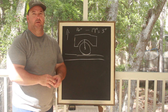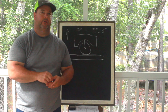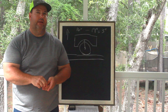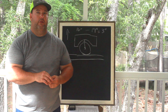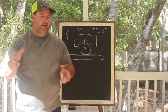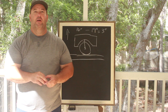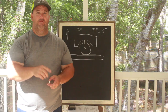Are you foot braking or using a trans brake or dumping a clutch? How much front end travel does your car have? How much power are you putting down — use the link in the description to calculate horsepower. What are your current 60-foot, mid-track, ET, and mile-per-hour times? Are you racing on prepped or unprepped surfaces? And last, the 12th: video, video, video! I need to see a video of the car leaving the line. It is a game changer. Guys, I hope this has been helpful — go fast, go straight, and be safe. Thanks for watching.